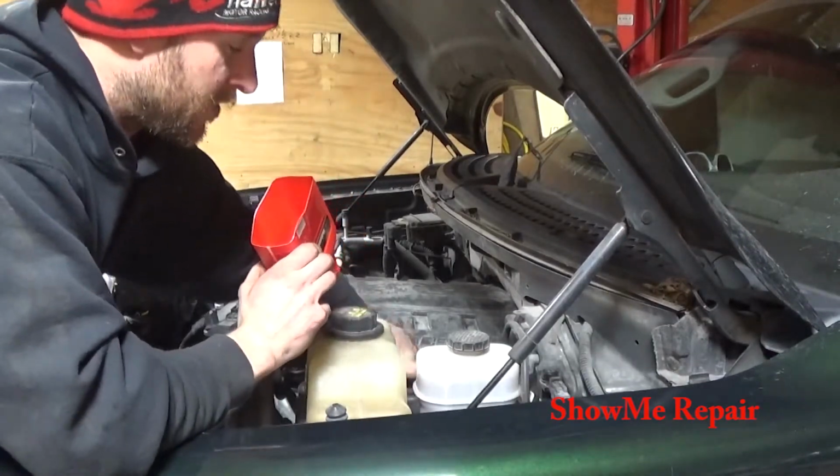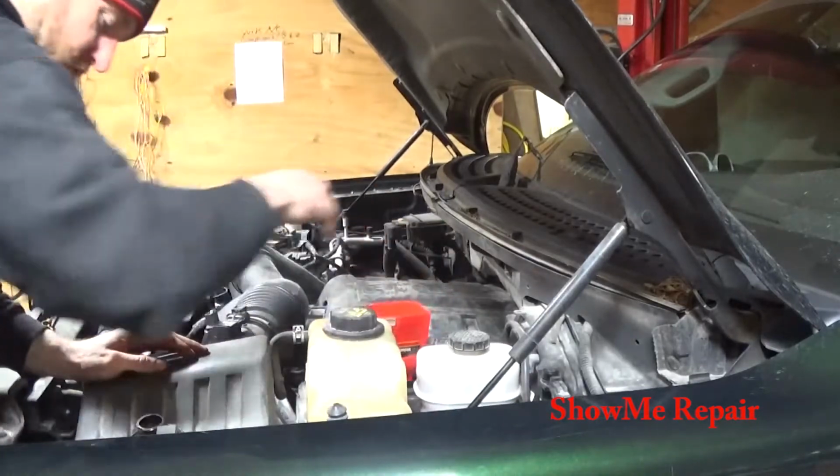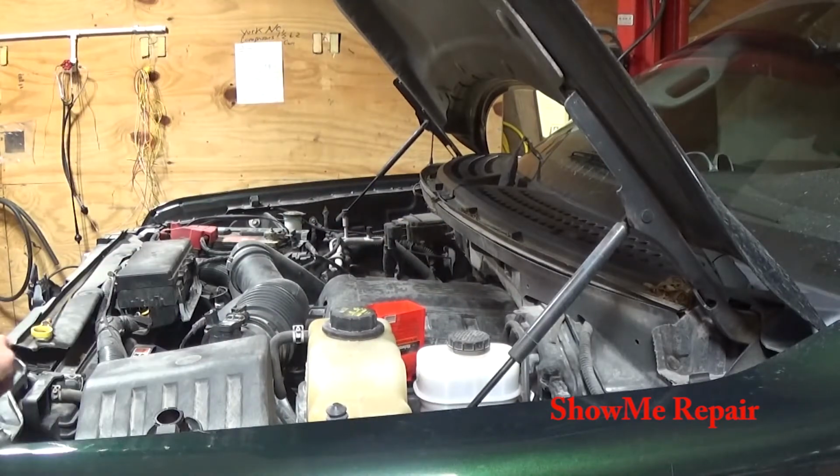Okay, time to pour oil in. I'm going to go ahead and do 6 quarts and then check the dipstick dry just to see. Well, no, that should be fine. I'll do 6 quarts because we're filling the oil pan. That's typical. We're going to be over. I've filled the oil filters, so then I'll start it, and then once I have oil pressure, I'll shut it off and recheck.